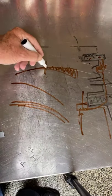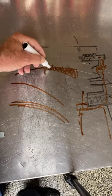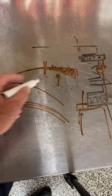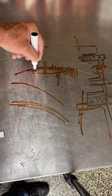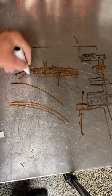Keep going past peak horsepower, and if you don't have good ring seal and if you don't have vacuum, you're just wasting time over here. Yes, you still get area under the curve, but the area under the curve is narrower than it is if you've got big crankcase vacuum and big ring seal.